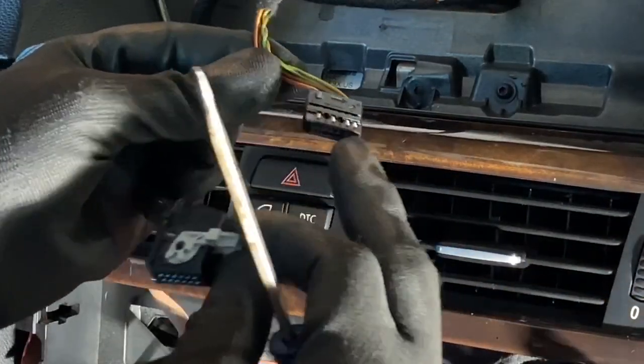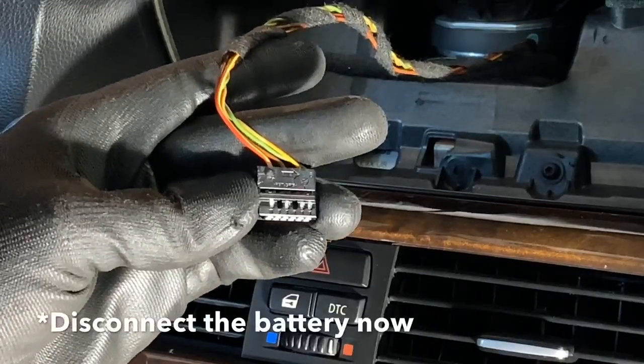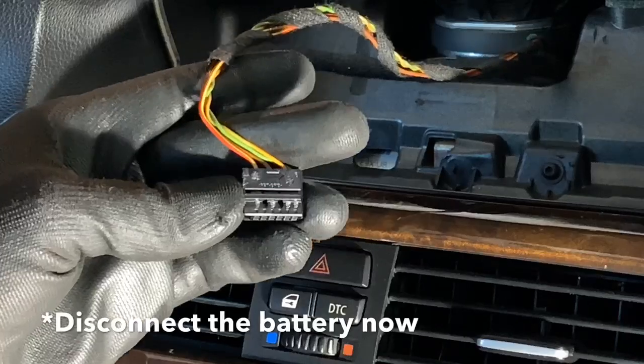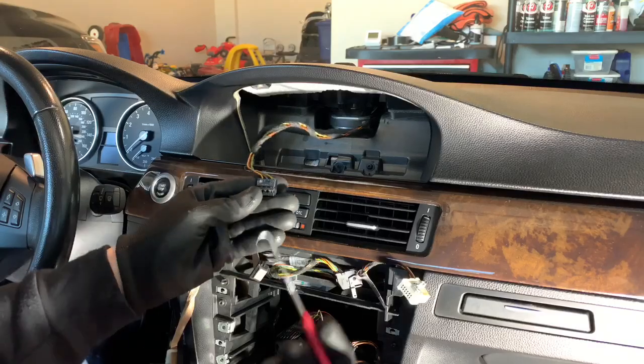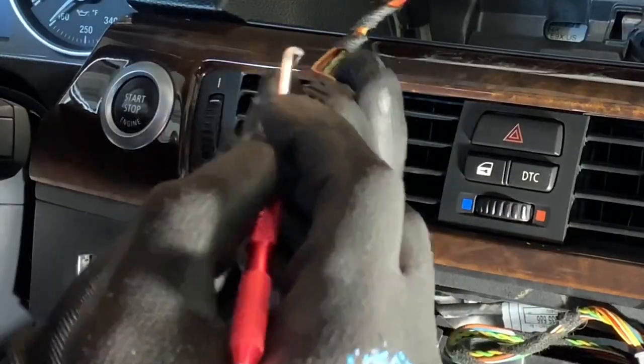This is where we need to take the pins out and push these wires on out. This is what it currently looks like. So I'll grab the new connector and then we'll look at Nick's sheet on how the new connector needs to be repinned. Next, start popping out all these wires. This connector, so I'm just taking my pick tool here.